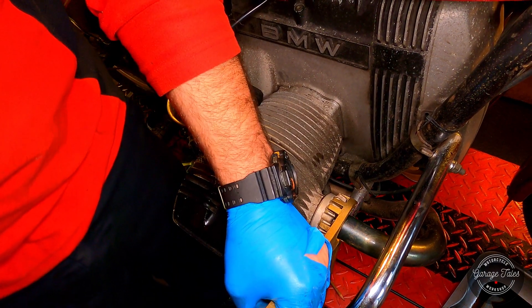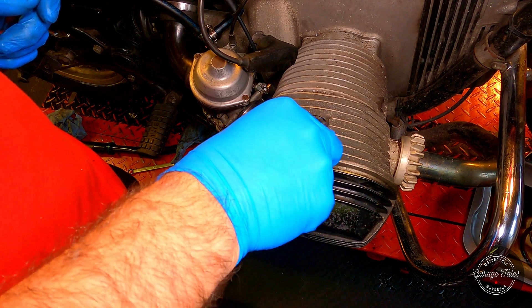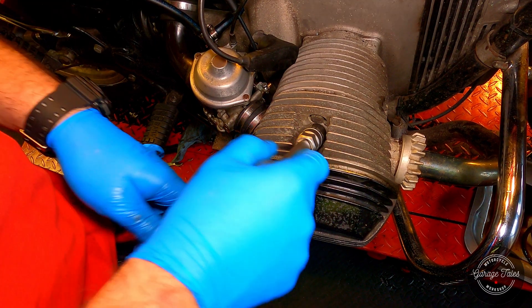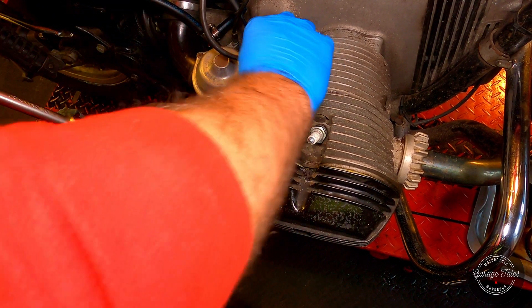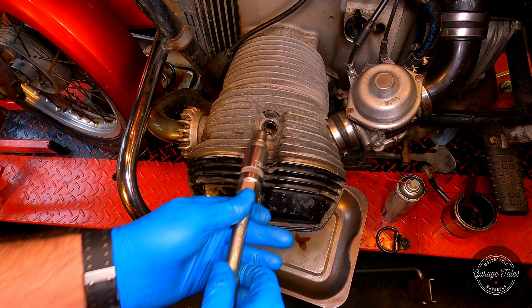You could just about see the groove I was mentioning — someone must have used a Dremel or some cutting tool on this at some point. I've just cleaned the threads a bit with a brass wire brush and now I'm applying some copper anti-seize, which should keep the threads from seizing for a long time to come. Give the nut a few taps to tighten it back up and we're done with that side. I'm reinstalling the old spark plugs for now just because they're clean — I'm just going to snug them down, but this bike will get new spark plugs before it leaves the table.